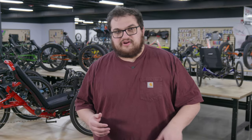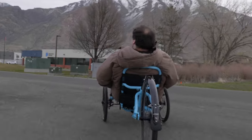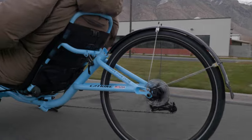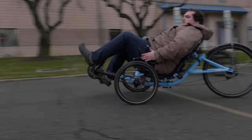I've ridden a lot of trikes in my tenure here at Utah Trikes. I've ridden the Trail and the 559, but never side by side. To test what we've been talking about regarding wheelbase, 26-inch wheels, and 20-inch wheels, I took these trikes out side by side. I took the 559 out first for 10 minutes around the shop parking lot and neighboring street. I immediately felt the low acceleration from the 559 — it took upwards of 2 minutes to get to a comfortable speed — but once I did, it was smooth sailing. I didn't have to pedal any faster to maintain my speed and could comfortably coast without dramatically slowing down. When turning, it felt like I was going too wide on most corners, and in some cases overshooting my turns, but the wider turning radius did not ruin my ride once I accounted for it.